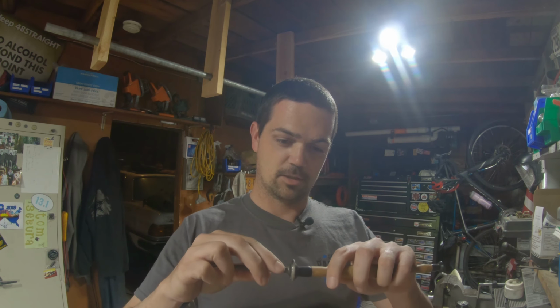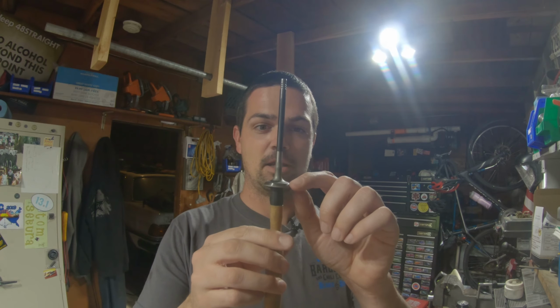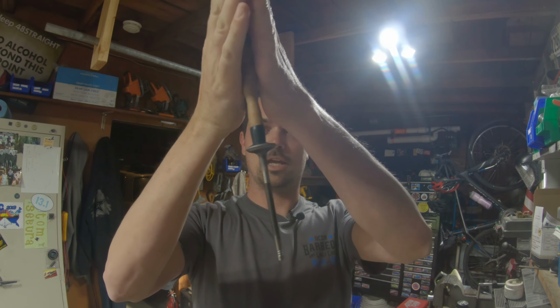All right, so now that the cylinder head is really clean, we can go ahead with the next step in this process, and that's called valve lapping. We're basically gonna take this really fancy suction cup here. On the back side, we're gonna use some valve grinding compound on that mating surface there, and we're gonna put the valve back in. Then we're gonna kind of rotate it like that, and that will make the valve and the cylinder head extremely close tolerance.